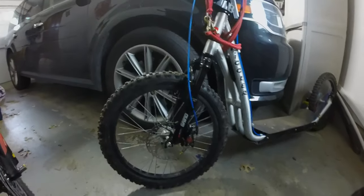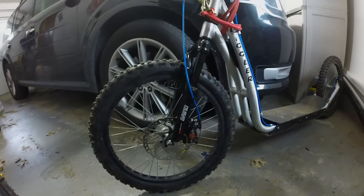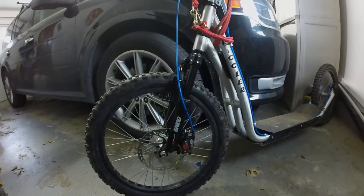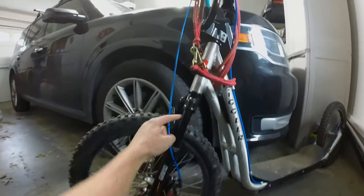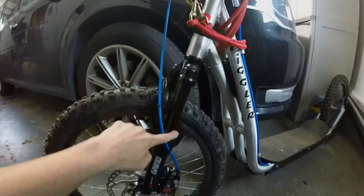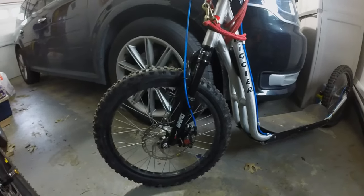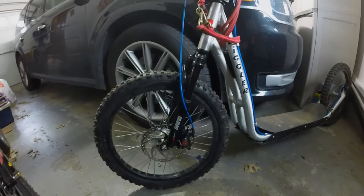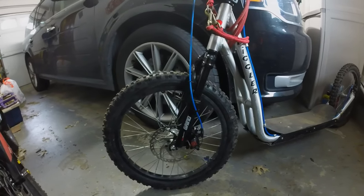Some of the basic parts. This one I have here is on a Diggler DSK, the disc brake model. It's from 2007, so it's quite old at this point. It's a coil fork, which means that there are literally giant heavy metal springs in each leg of the fork, and that's what gives the suspension action. It's not as nice and smooth and adjustable as an air fork, but it really does do a good job if you take care of it.